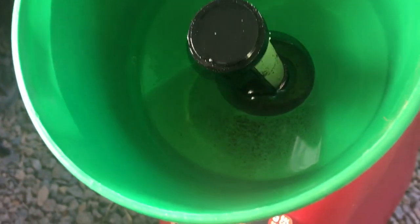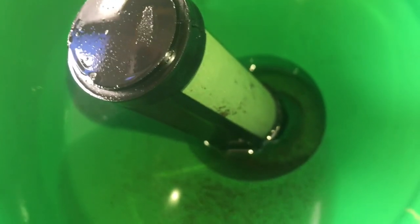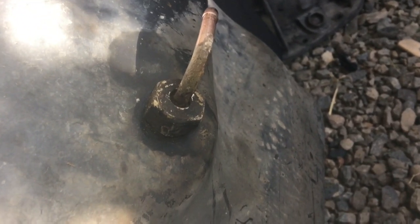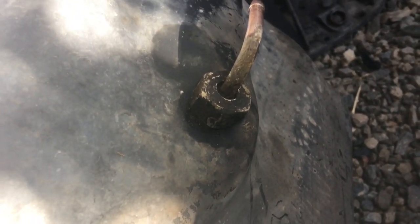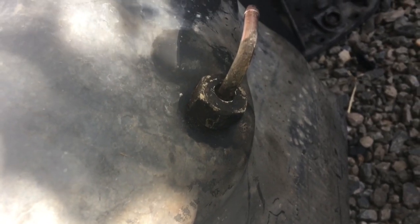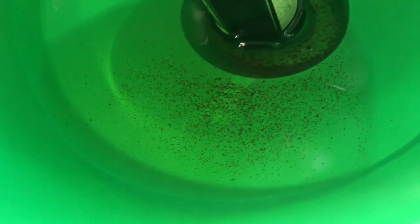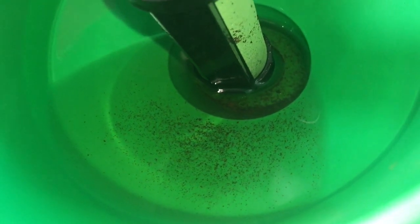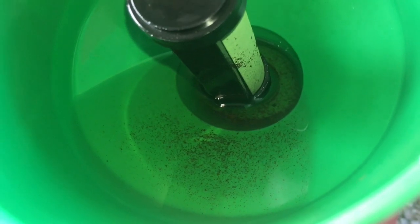The main reason we're getting a new tank: if you look at the filter funnel it's got little bits of rust and crap on it. In the old tank, underneath the spigot, there's supposed to be a little screen mesh filter — and it's gone. With the new tank I got a new filter, all new seals. It's probably blocking up the regular fuel filter too, so I'll go to the auto parts store and replace that as well. That's what clogs up your carburetor jets.